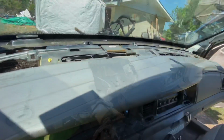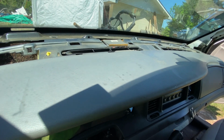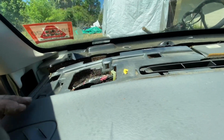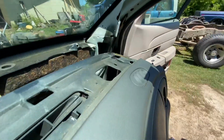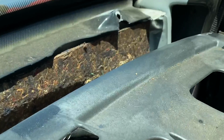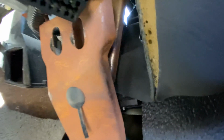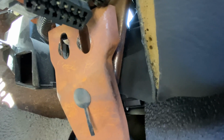Bear with me. Well, y'all, the dash is out. For any of y'all curious on where all the bolts are, it's not many. Very simple, actually really the easiest dash to remove. Bolt here, you see the clip there. Same thing right there, the clip's back there. And then that far corner, zoom into it, there it goes right there. Those are all 7mm. See if I can get underneath here. There's 2 spots right there. There's bolts that go through there. They are 13.